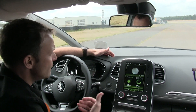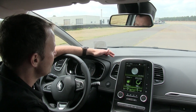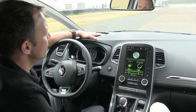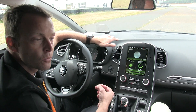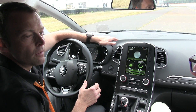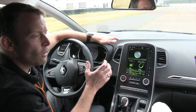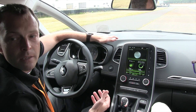We have some side effects of this 48V system regarding comfort and drivability. First, what I want to show is start-stop. We have an extended start-stop - this means the car begins to stop below 8 km/h. After the restart, we have a really smooth restart because we have a belt starter generator, which is connected via a belt directly to the crankshaft.